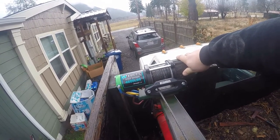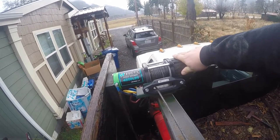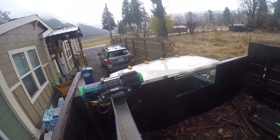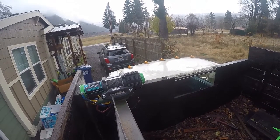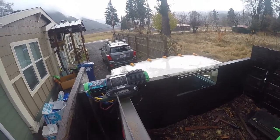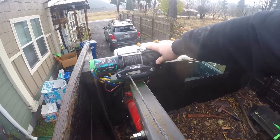The winch — I've had several on here. A couple of the cheap ones would just burn through relays in the relay box. The winch ratings are pretty arbitrary; a 2,500-pound winch struggles to lift something way under 2,500 pounds. So I ended up going with a 4,500-pound rated one, the most recent one, and I love it.